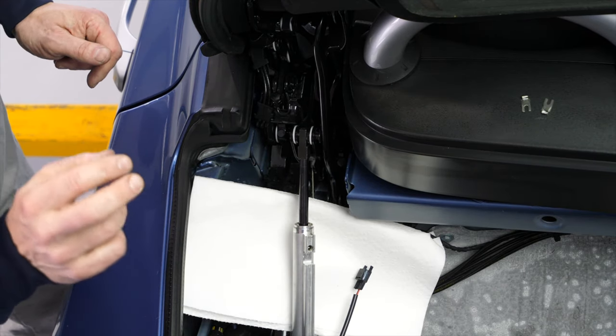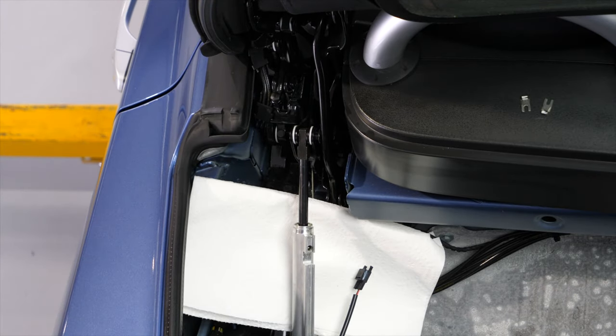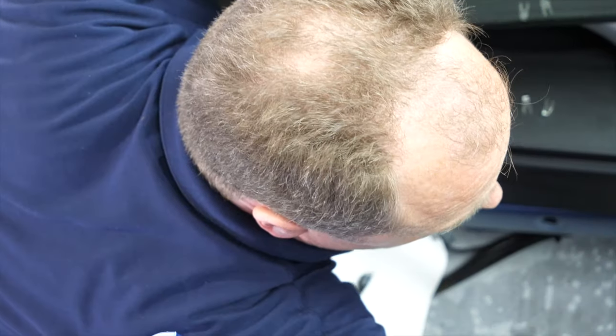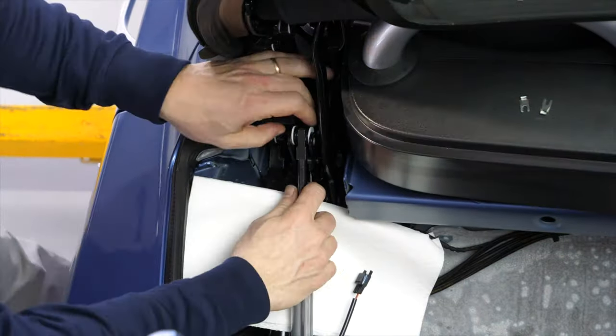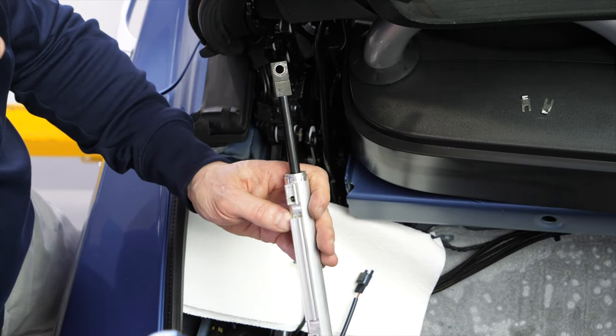So let me get the support off on the other side, and then I'll just quickly pull that pin out. By taking the support out on this side, I meant just my little cardboard tube that was holding up the rear bow. Now I'm coming around, lifting my top up a little, and there I am. Have enough clearance to get the pin out. Put the top up again. Put my support back in. And here is my upper cylinder pin removed, and the cylinder is out now.